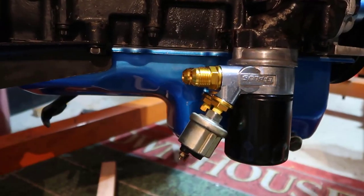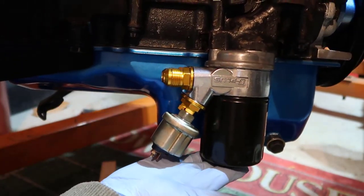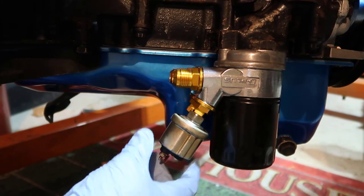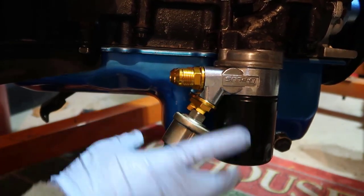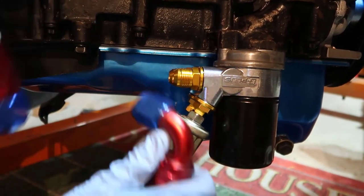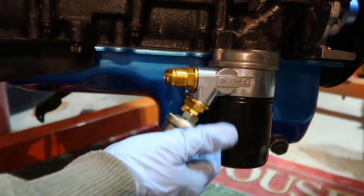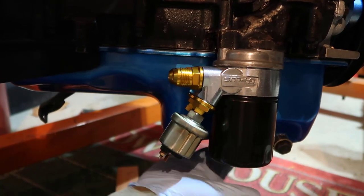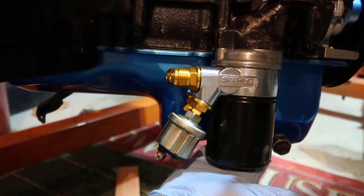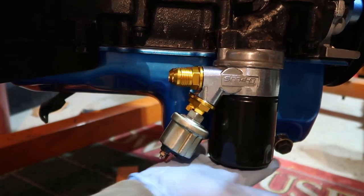The engine is moving because it's on the hoist. I'm almost thinking this placement might be a bad choice — I'm concerned about the oil cooler cable. You don't want the cable hitting the ground. The filter should be safe because it's smaller, and the oil pan is lower, so those two should be okay.